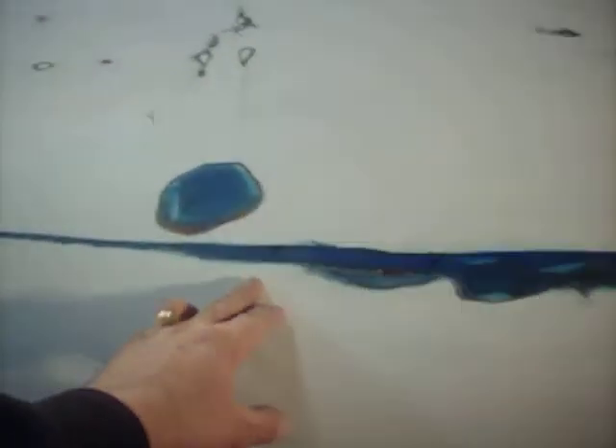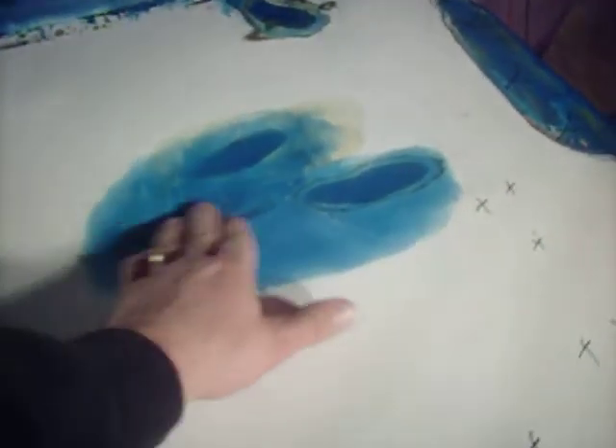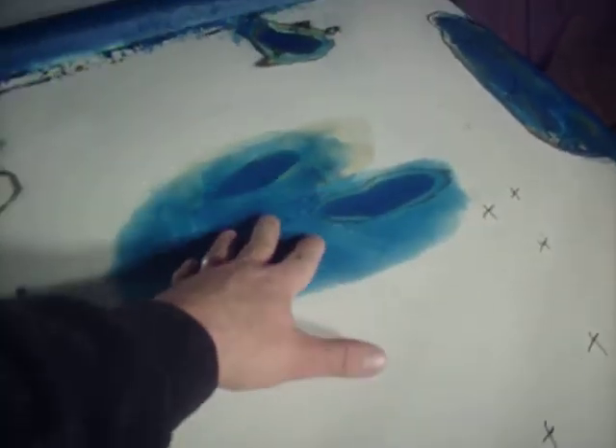I'll be doing all the small holes now with the Marine Premium Filler with bubbles. The other places I used the high-strength stuff were where I had that crack where it was a little bit deeper — a spider crack there. The area where I had the crack from the rollers, and on the back area on the transom. The rest I'll be doing with the Premium Filler.